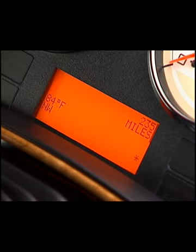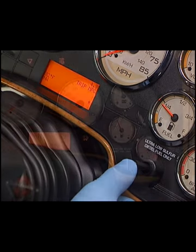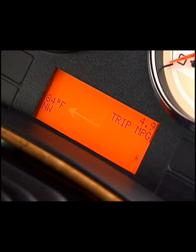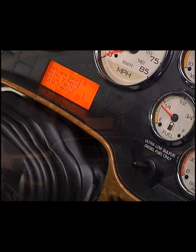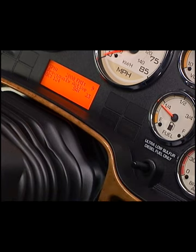The digital display below the speedometer and tachometer is arranged in four quadrants. The quadrants can be individually displayed and navigated using the display control button. Some of the options currently available include general text and warning messages, compass heading, outside temperature, fuel economy, front and rear axle load, and transmission gear position. Some messages are used in conjunction with cluster warning lights. The digital display can also be used to retrieve DTCs if the vehicle is optioned or programmed with this feature and not equipped with the vehicle information display.